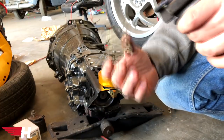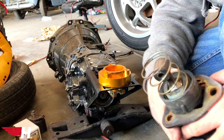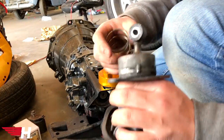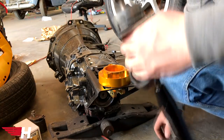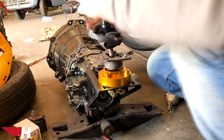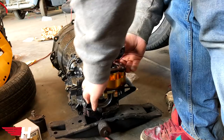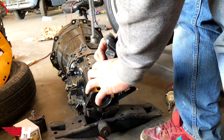With a 350Z linkage or G35 linkage, you have your spring that goes in here. Then you pull this down a little bit, which helps out. Push this into it. On this, if you see that little line right here, it's gonna match up with this little divot. So you get your spring, install the spring right here, upside down. And then that fits just like it was from the factory, bone stock. Definitely doesn't look like it has an LS, real sleeper. Get your stock bolts. Stock bolts slide right in there and give you no problems.